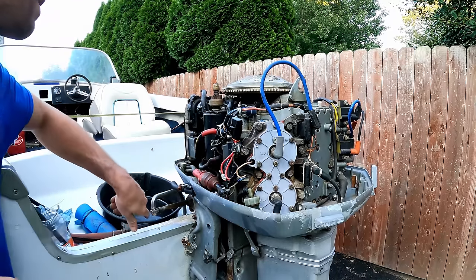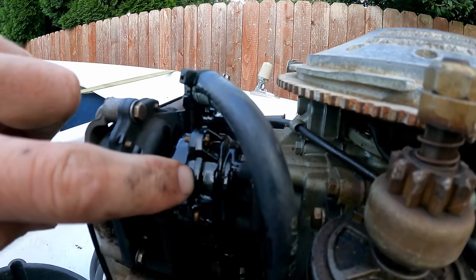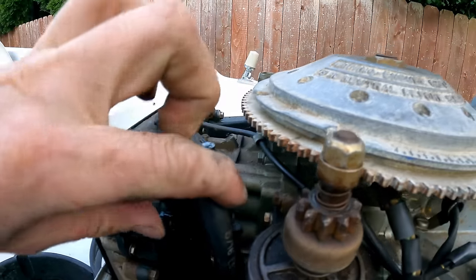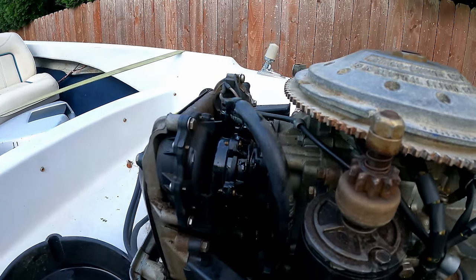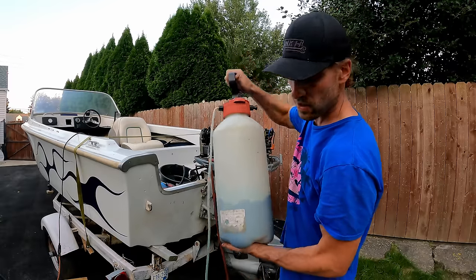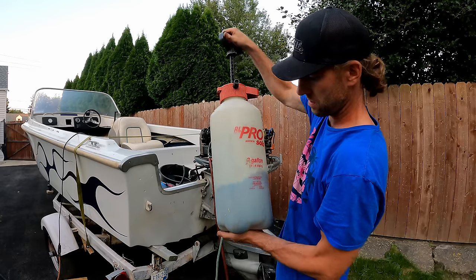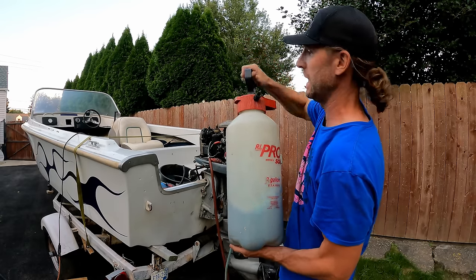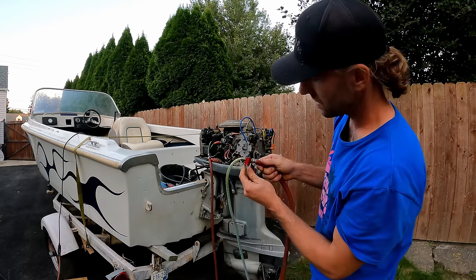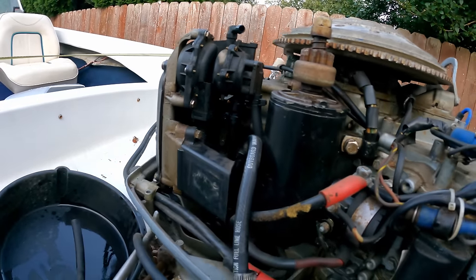Don't know if you guys saw that, but you can see this gasket is not sealing on the pump. We'll just pop it off on the top up here. We've got the new and improvised fuel tank. It's a chemical resistant, 3 gallon. Works very well. And we can open the petcock. And I can hear those carburetor bowls filling up.